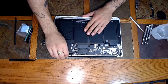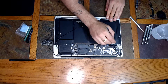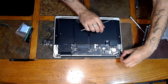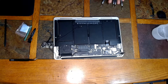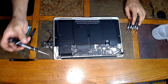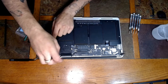There are going to be three screws holding the display in on each side. Before we actually do that though, you're going to see this cable needs to be disconnected. This little black switch here — what you're going to do is lift it up, pull it over to the other side, and that'll just allow the cable to come off. The toolkit I purchased specifically for this video did not actually have a T8 — Apple's really good at making sure you need a wide variety of uncommon tools to work on their products. I have one in my toolkit and I'll make sure the link in the description has the proper one. There are three screws on each side — just take those out.